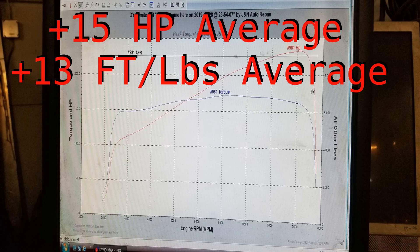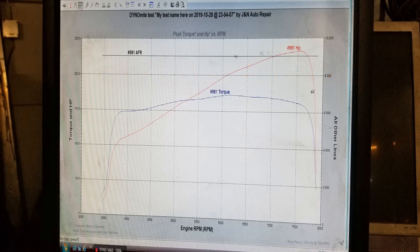Because this is a stock motor, I really think an upgraded set of valve springs and the Euro cams — the F20B manual cams are pretty decent from the factory, but a little bigger set of cams and you would start to really see some big gains in the higher RPM range with the CNC manifold. Having the bigger plenum spacer, the larger throttle body, and the upper being gutted, you really see that power roll in at about 6800 and up. If we could spend some more RPM — get it to probably 8000, maybe even 8500 — this thing would just really be an animal.